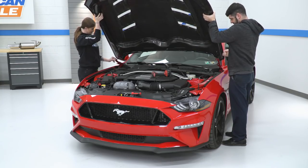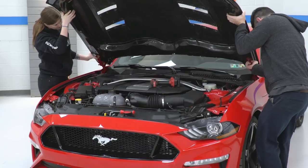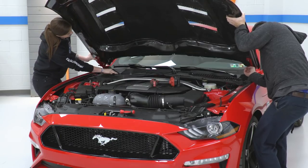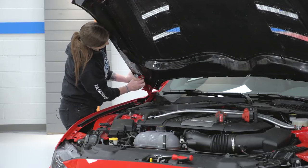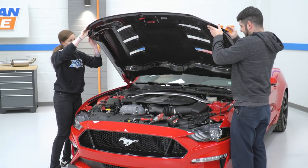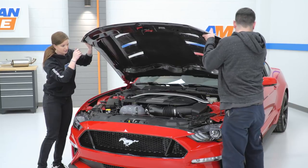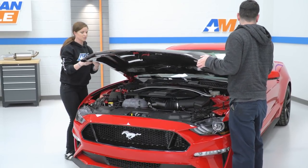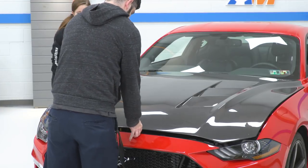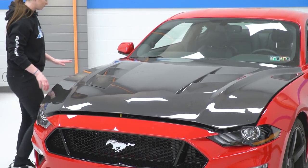A second set of hands is really gonna help you out here. Joe and I are just gonna work together to line this up and get it bolted into place. The first thing you're gonna wanna do is get your hardware into place — don't worry about tightening it down yet because you might need to align the hood a little bit. We're gonna leave the hardware loose, lay the hood down, and figure out the adjustments we need to make before we tighten the hardware down. Watch all the corners and make sure you're not going to chip any paint. With the hardware as loose as it is, Joe was able to latch the hood and we can wiggle it back and forth to make sure all the lines are correct before tightening things down.